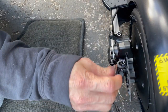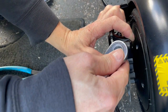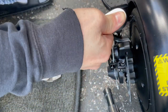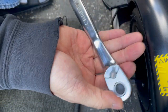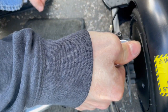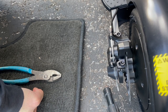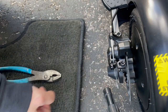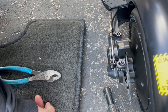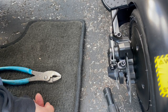That one's good. This one needs to move in a little bit. A little bit like that. You notice I'm tightening this holding it right here — not holding it all the way to the back. If you hold it all the way back, it's too much leverage and it's going to strip the threads. Now you see it pushing the rotor in — that means the pad on the inside is not touching the rotor. So that's good.